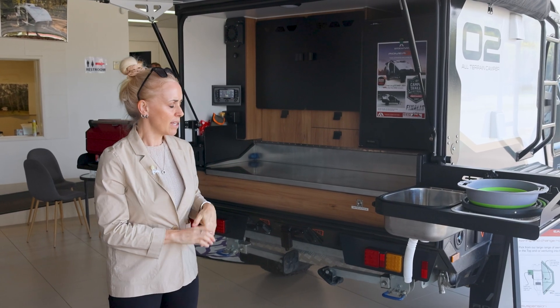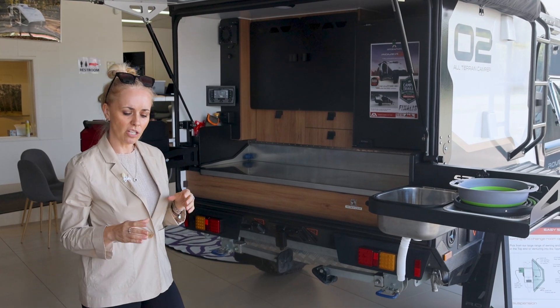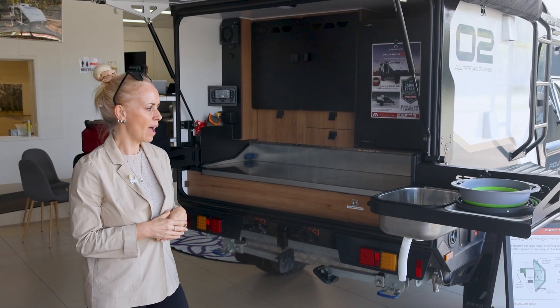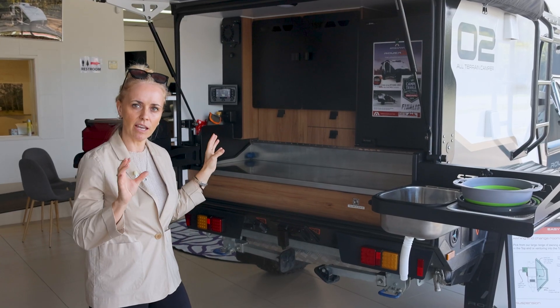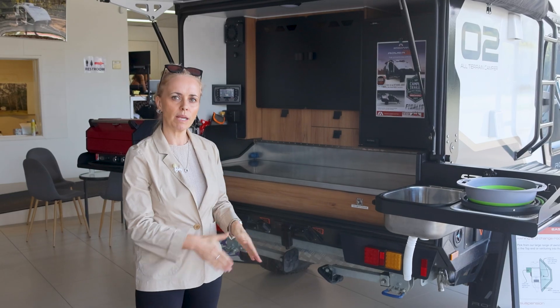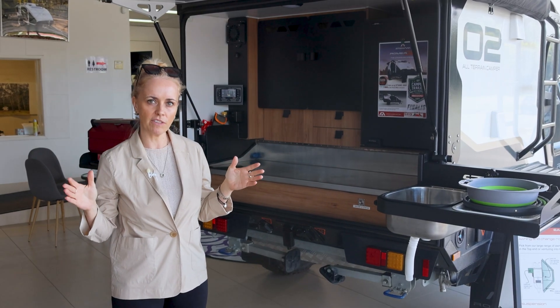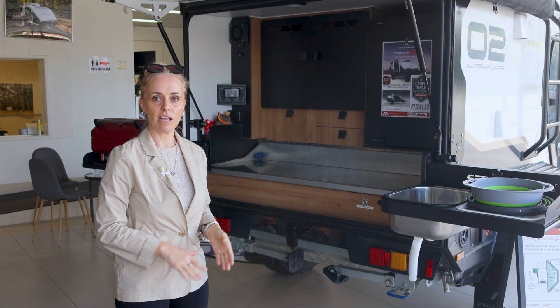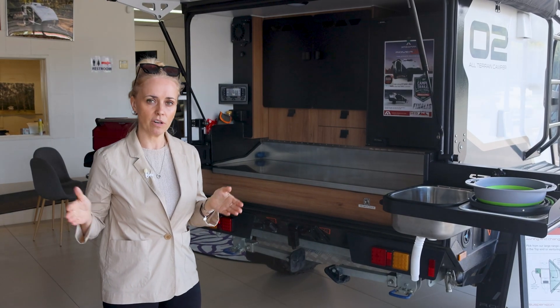What I tell people is that ideally you are not charging up your unit with that full 600 amps in one day. Ideally you're using between 60 and 100 amps per day depending on outside conditions, so you would be able to go camping for four to five days without replenishing the batteries — and if you are replenishing the batteries, that could be extended by another three or four days.